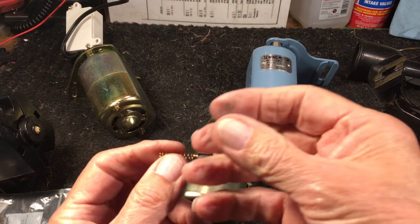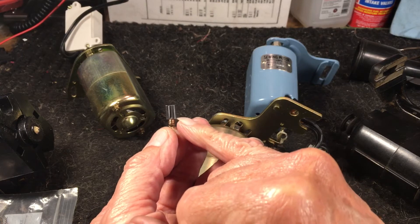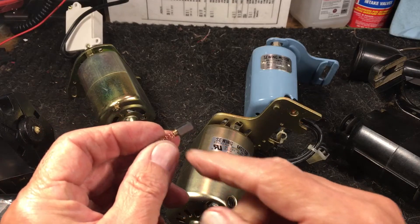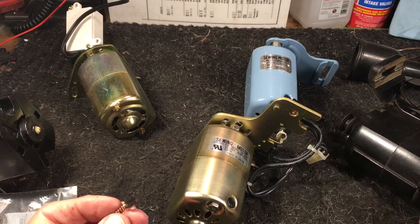And when they get used up, they'll burn down. It's like a pencil — pencil lead. It's just carbon like a pencil lead, worn all the way down. A lot of times they'll be sparking on just the spring. The spring will be conducting electricity and they'll be arcing and sparking. You'll be flipping the hand wheel on the Kenmore trying to get it going.